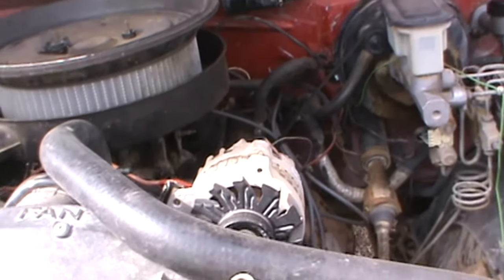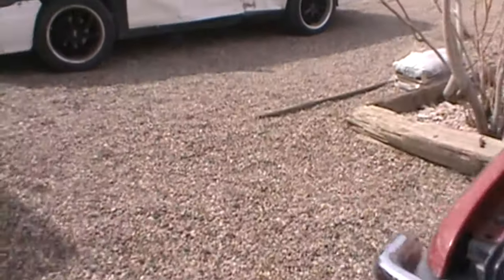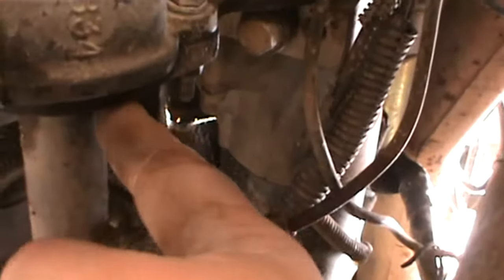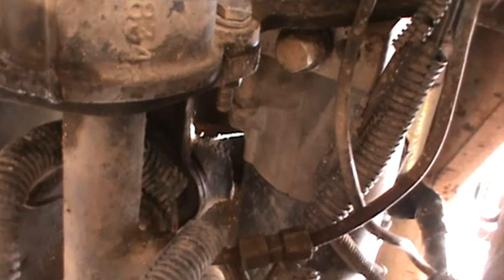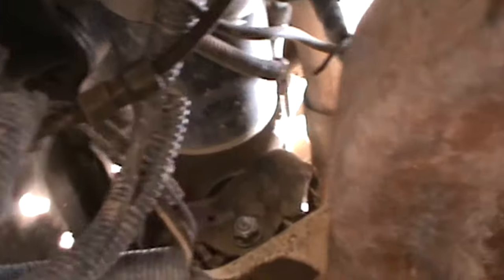So, the line was a half inch down there. I don't know what size nuts I have on down there, so we'll just take everything. And what we're replacing down here is this guy. This is the slave cylinder. It is old. Honestly, this is probably where it's leaking, from here, down in here. Got some oil down there, yep. So the seals in the slave cylinder are what's bad. And honestly, that's probably what's going to go bad first, is the slave cylinder.